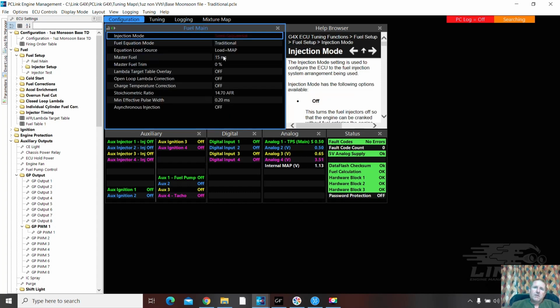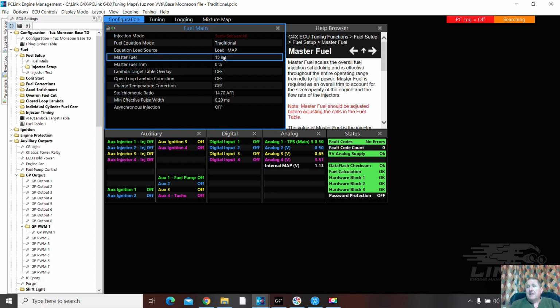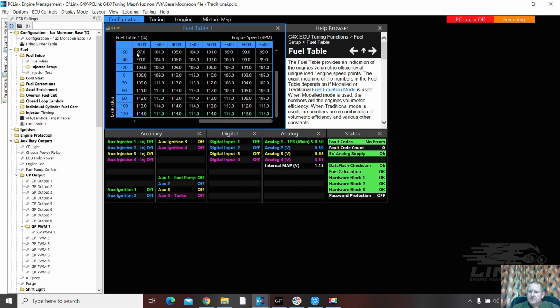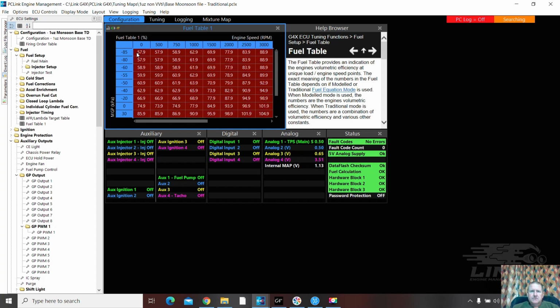sit on the master fuel. I don't normally set up in traditional. I set up in modeled. So I haven't set up in traditional. I'm trying to think when I did a traditional, and it was quite a while ago. Give me a moment. I'll see if I can find some numbers that might be just a little bit closer in one of my past G4 maps. There was nothing really that I'm happy to fire across. I actually think this map might be just a little bit on the rich side, so I'm going to pull it down a bit. What have I ended up here?